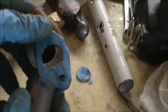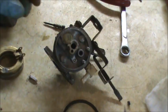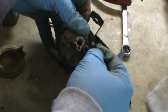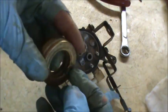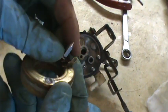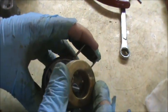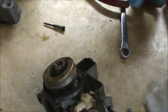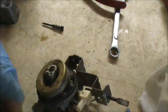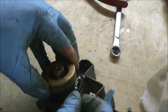Here it is — we have it all lined up and things are looking good. I got a new bowl gasket, which is really nice and soft compared to the old one, so that'll go on there. We're going to put our needle — there's a little clip here, you want to get that right on there. We're going to line that up, set our float and needle right where it needs to be, and put in our hinge pin, which should slip right through.